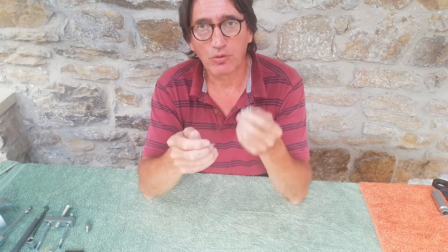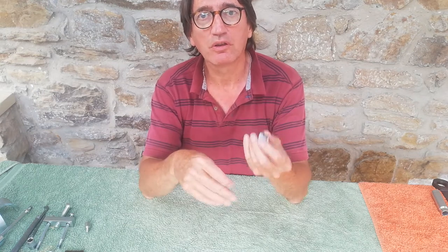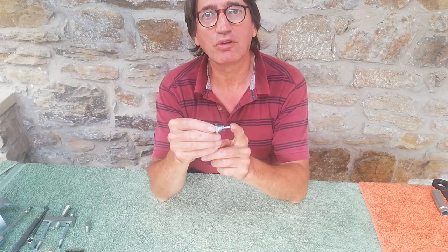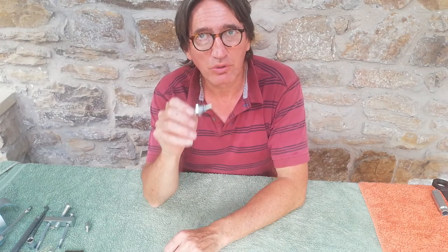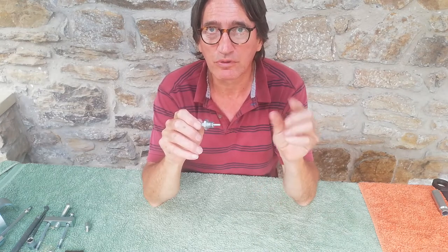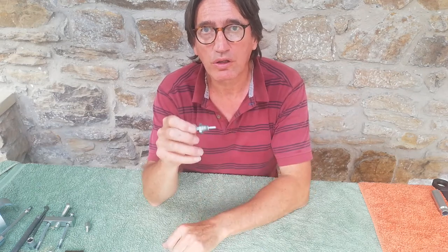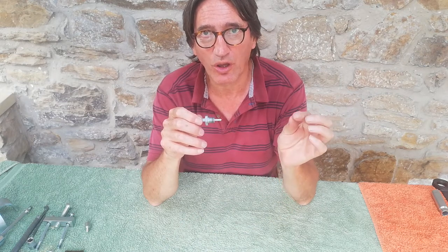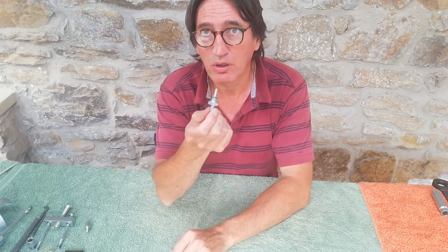This is a timing tool — on a Mark Three there's a little plug on the timing side of the crankcase, just below the timing case. You take that plug out, screw this in, and when you turn the crankshaft over there's a little slot which this pin locates directly with, holding the crankshaft at exactly 28 degrees before top dead centre. Then you go around to the drive side, where there's a little marker that can be moved. The idea is you lock the crankshaft with this and then adjust that marker so that 28 degrees is directly opposite the timing mark. Simple tool but really good.